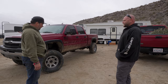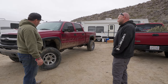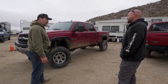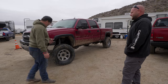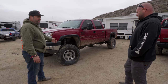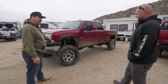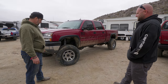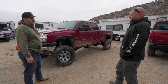This is our six-inch kit. I got it as low as possible but wanted the option to bring it up higher. When I do 40s I'm going to put a longer shock on it — my goal is 40s after I burn through these 37s. The 37s are on H2 rims, 17-inch, eight-on-six-and-a-half bolt pattern. Then you did a wheel adapter to go from eight-on-six-and-a-half to eight-on-170.